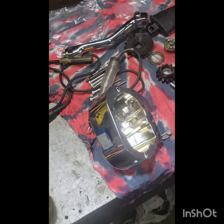Alright, so at first we had it kind of sitting like this, but then we realized that it just had to be moved one flat. But basically, once everything's in place, that's it. There's another piece that just kind of screws in there that holds it down, and that's this guy right here. And I found out the information for those flathead bolts. They're 120 to 140 inch pounds of torque. But like I said, we're just going white knuckle tight.